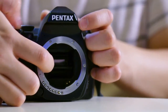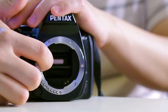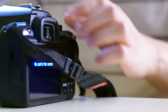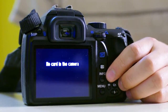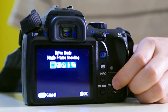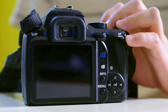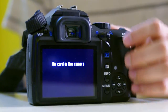If I switch it off and then turn it back on, the mirror fails to reset correctly — my finger is still holding the aperture lever down. Now I've power cycled the camera. Notice what happens when I start pressing buttons — every button I press, every dial click causes the mirror to cycle. This is precisely the mirror flop problem that some of you have been experiencing.